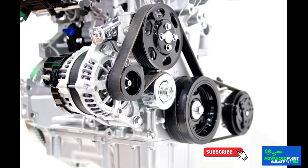However, it is not the same as the timing belt — many people confuse them, but they are completely different. Without the serpentine belt, charging your cell phone in the car or turning the steering wheel smoothly would be impossible. It can be easily seen when you open the hood, as it rotates at the same time as the engine. It differs from the timing belt in that it operates externally and moves components via pulleys.